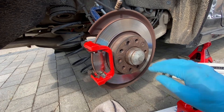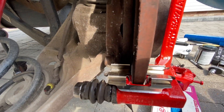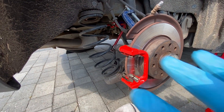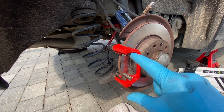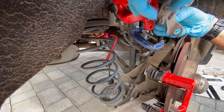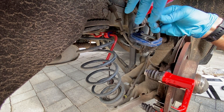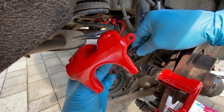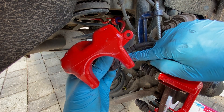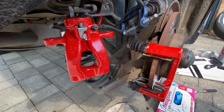Back around this side now we can see it's really starting to take shape. Just a quick check - the handbrake's not on, there's no rubbing, and the little stainless steel clips in there are nicely aligned - no rubbing top or bottom. Next up is to get the caliper back on. In reverse order from how we took it off, first we'll get the hose reconnected. Now we've got the hose back in there - the torque setting for this is only 14 to 18 newton metres - so just get a spanner on there and make sure it's nice and tight.